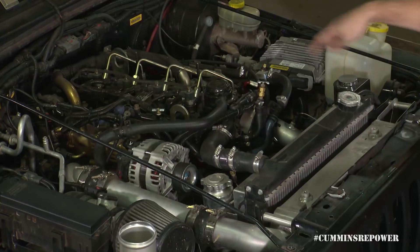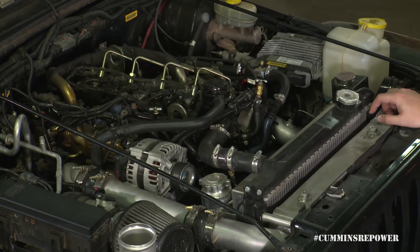It didn't happen overnight. This Jeep was originally equipped with an inline six, a naturally aspirated gasoline engine. Our engine is turbocharged, so some things need to change. The first noticeable change is we had to move the radiator back — which we could do because we lost two cylinders — but we added a charge air cooler. Once you have that hot exhaust gas spinning your turbine wheel and compressing your intake air, that intake air is hot and you've got to cool it down before it goes into the engine. You'll get a malfunction if you go above 197°F on that intake, so it's important to spec a charge air cooler that can achieve around 1,200 BTU of heat rejection to keep those intake temps cool.